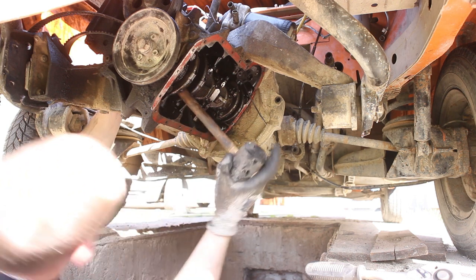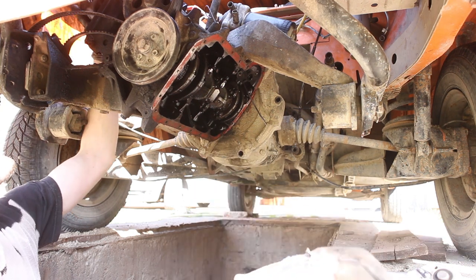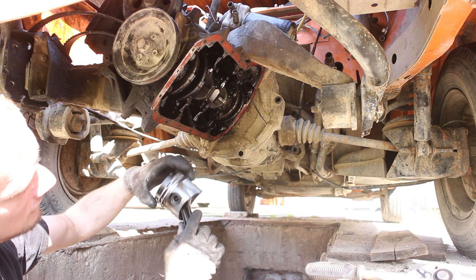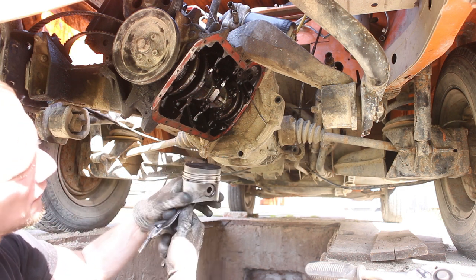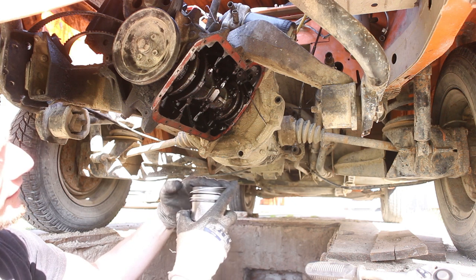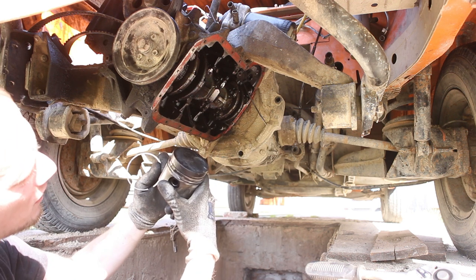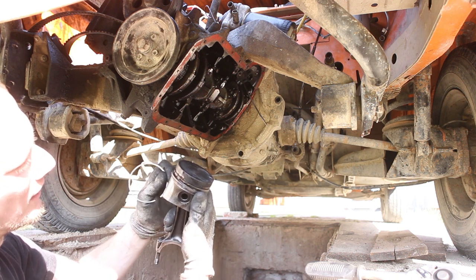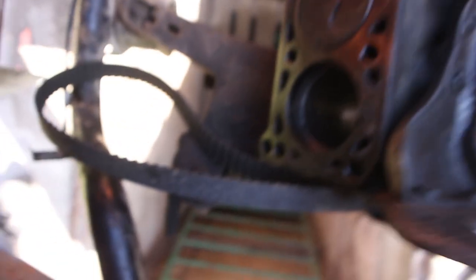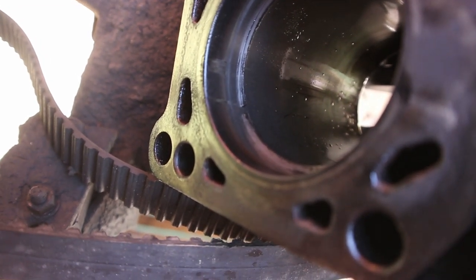So let's get out the piston. Pop a ring off and put it in the bore to see how it's pretty worn down. So let's check a gap on it. So I just put the ring in. Can you see the gap? Yeah, it's pretty nasty.